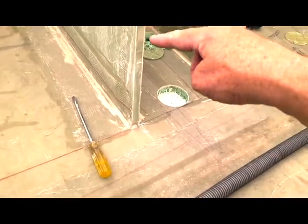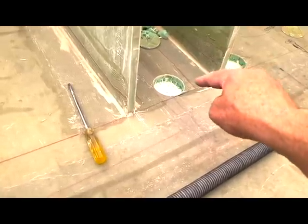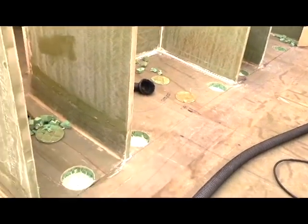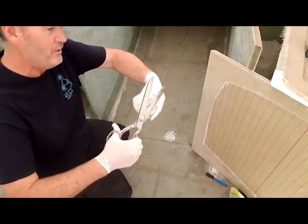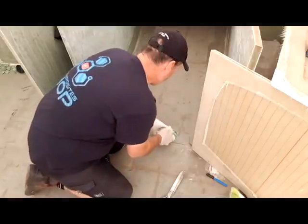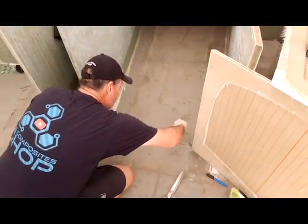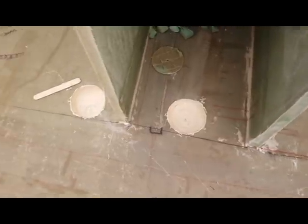The water drips down, hits the bulkhead, and falls straight down the hole. If I left a gap between the wall and bulkhead, water could pool and ultimately cause rot. I need to fill the core before I can glass these, so I'm using a piping bag to get the filler compound in. They're not pretty but they're cored — I'll let them go off, sand them back to raw glass at the base, and patch with some nice big pieces of 600 double bias.